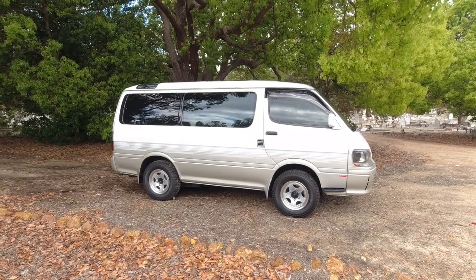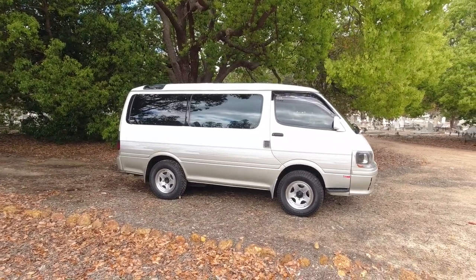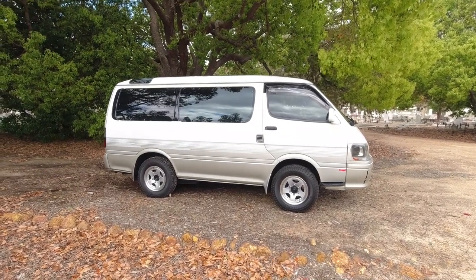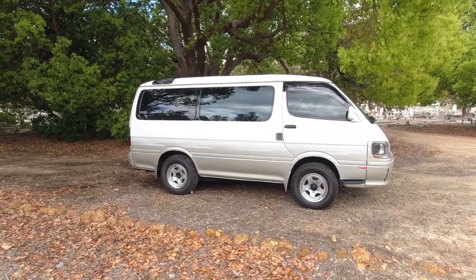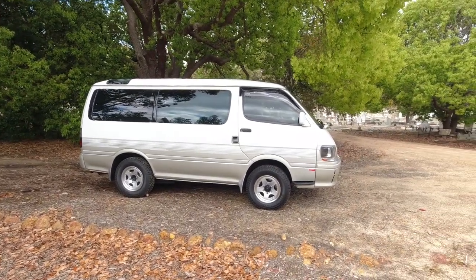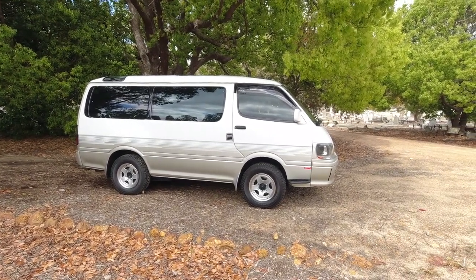which would indicate that the car's been living near the seaside, used at the docks, or driven on the beach frequently, that the inside underneath of the sills down the side where the sliding door is and on the other side is relatively rust-free and clear of any salt and debris, and that the rear of the vehicle, the suspension, just like the front, the shock absorbers aren't damaged, rusty or leaking, that the CV boots on the front and suspension boot covers are in place